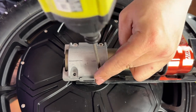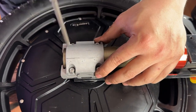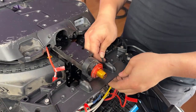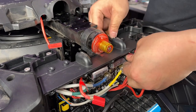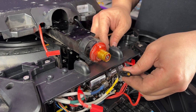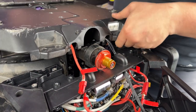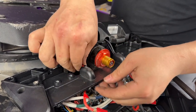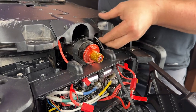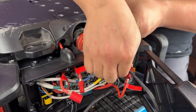When reinstalling your batteries, the black cable is fairly long so you can route it into the control board holder first. The strategy for threading the black cable into the motherboard holder is to have the small piece of the terminal facing upwards. The red cable is a little bit shorter so you'll need to move the battery pack up — just be careful not to pinch any of the battery terminal cables. Again, the small part of the terminal faces up; insert it and then twist it counterclockwise slightly to get it through.